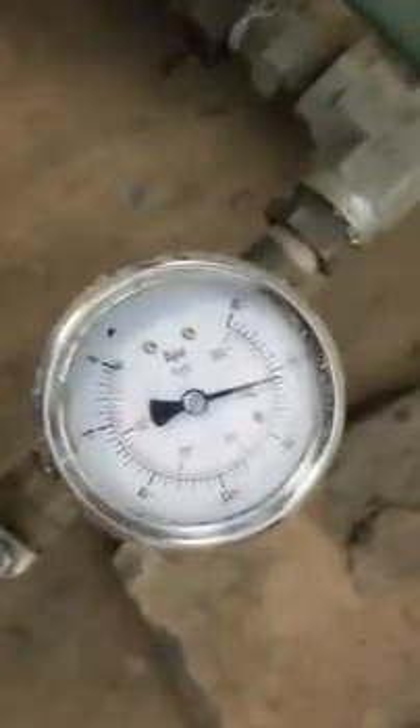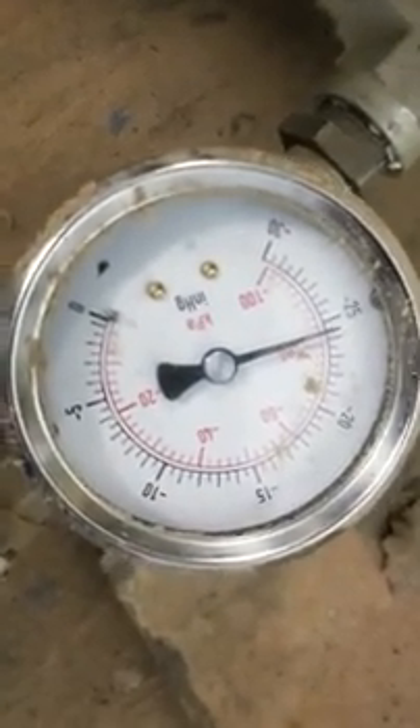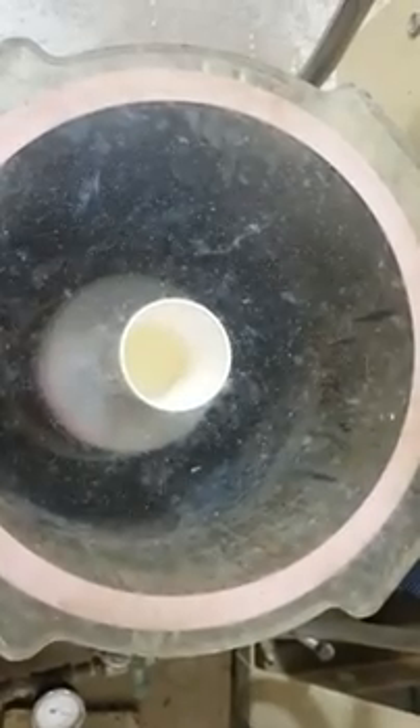That's about where I see air bubbles starting to form, and that is 24 inches of mercury or so. Whether the... I can easily draw that with a syringe, quite easily. But whether the fuel pump for the diesel heaters actually draws that much is a different matter.